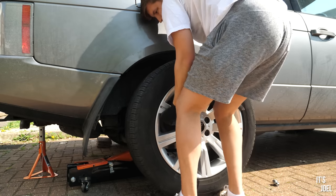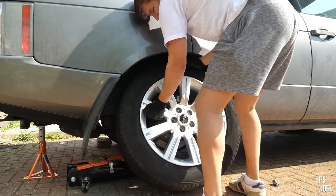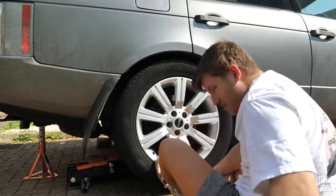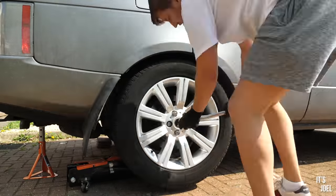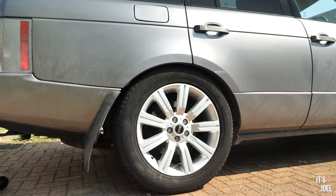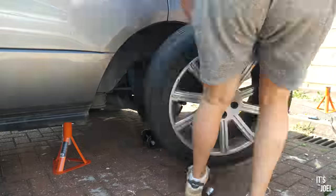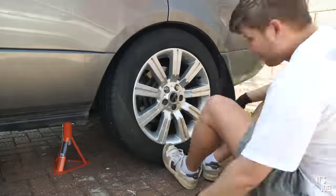I wonder if JGS 4x4 supply new backbones and hip replacements on their website. That was probably the trickiest thing about replacing the two rear wheels. They're just so damn heavy. I ordered some new 22mm wheel nuts all round to replace the corroded originals, opting not to reuse the locking wheel nuts. After replacing each wheel, I let the car back down and started it up to let the air suspension recalibrate itself. Jacking it up seems to somewhat confuse it and leave one side looking like it's collapsed. Nonetheless, letting the air suspension reset after each change seemed to work for me, although I'm sure this is probably not the conventional method.